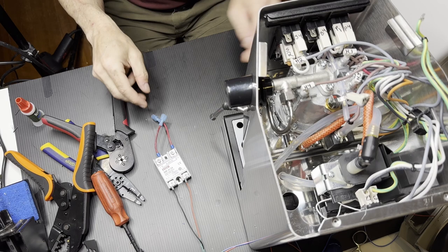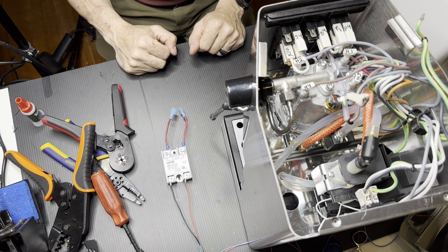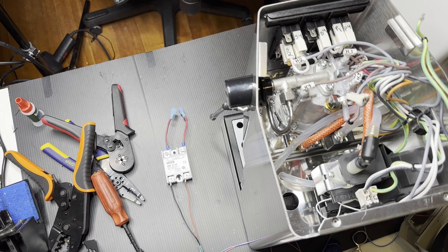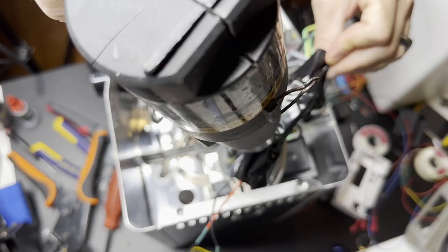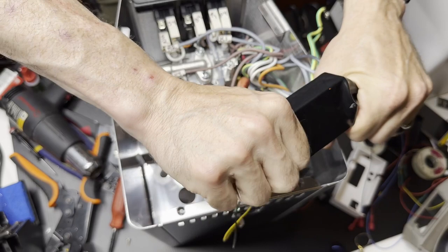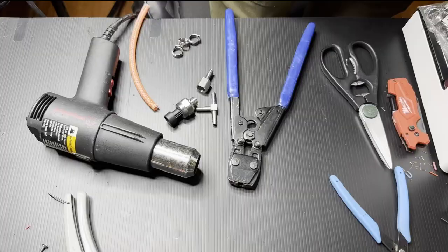This will allow the microcontroller to send high voltage out of the SSR into the heating element. You're going to want to insulate those screws — you could wrap electrical tape around it or have a cover over it. Some SSRs come with covers, some don't, but I'm taking shrink wrap normally used for 18650 battery cells and putting it over everything, then just tucking it in.